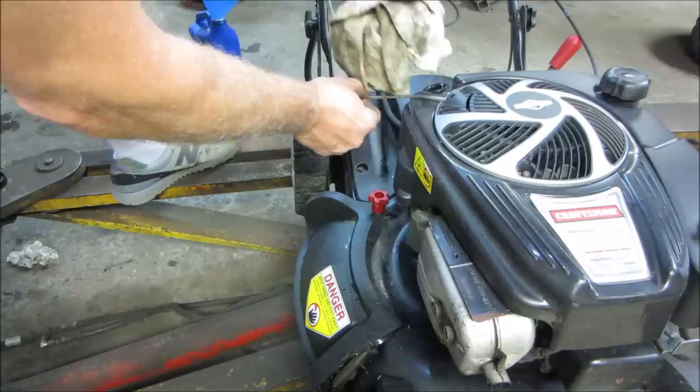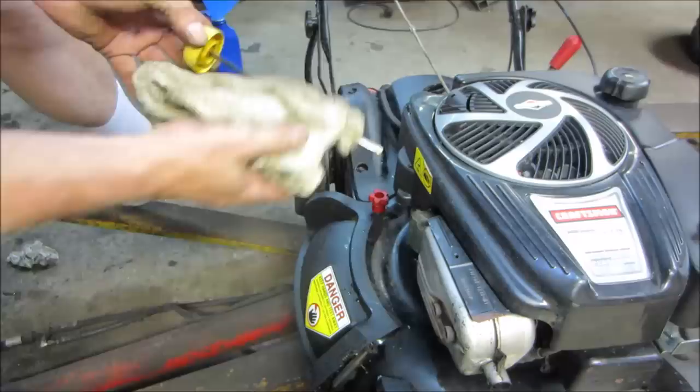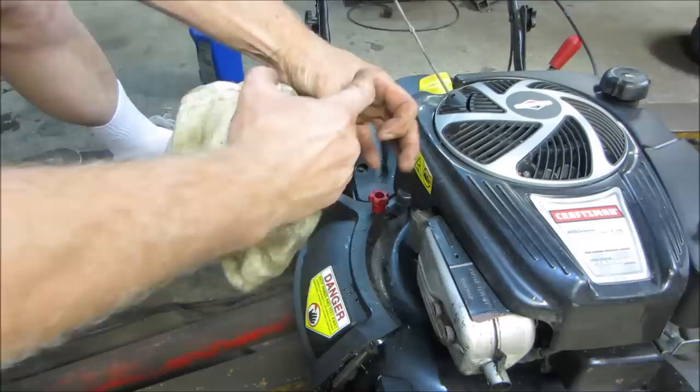We are right about at the top dot again. That should be good. Sometimes what happens when you're putting oil in, the sides of the dipstick enclosure is wet with oil, so when you put the stick in, you kind of get a false reading. So when we run it, last thing we'll do is double check it one more time.